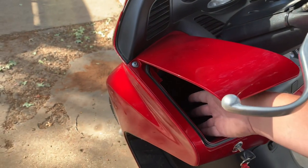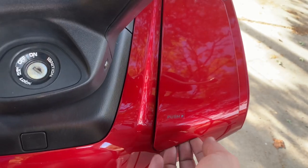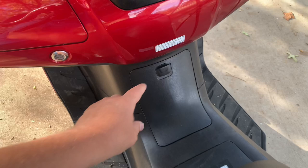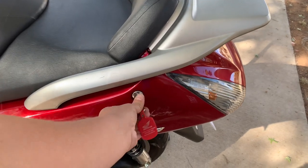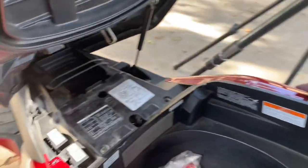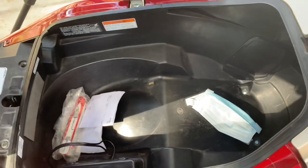You have two storage compartments. One is lockable — put your key in and turn it — and it's a deep compartment; my hand goes almost to my elbow. On the other side there's a compartment you just press down and lift, which is much shallower but a nice place for knickknacks. Between your feet there's a little fuel door that opens up for the fuel fill. The lion's share of your storage comes under the seat — put your key in, turn it, and you have over 50 liters of storage. It goes way back under the rear fender with plenty of room for two full helmets or two bags of groceries.